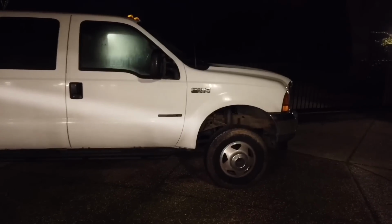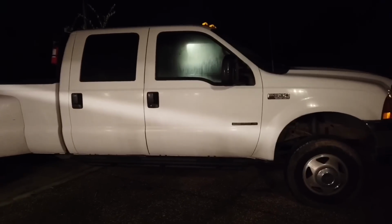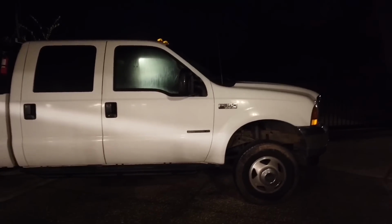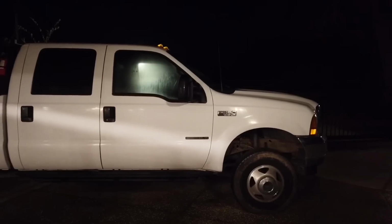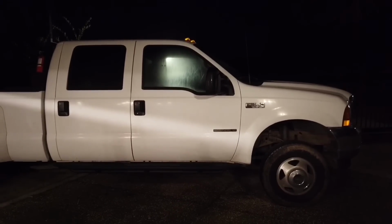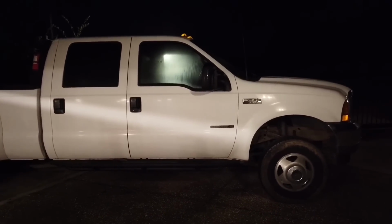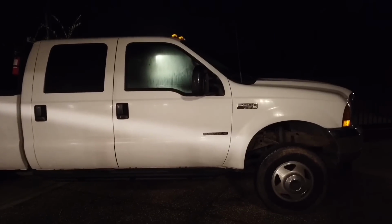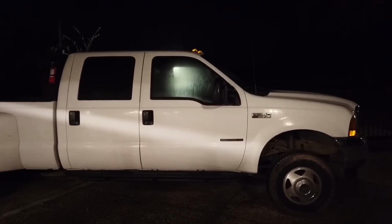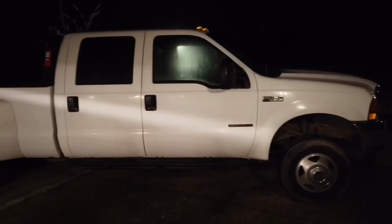All right, as you guys heard, she starts really easily, no problems at all, no hesitation. Idle's fine, no issues whatsoever. So I'm gonna let her run for, I don't know, maybe 20 minutes, 30 minutes, we'll see. And then I'm curious if she's gonna stall again. Hopefully in about 15-20 minutes she'll be up to normal operating temperatures, and we will swap the sensor and do the same thing. We're gonna actually start again and compare the difference, how she idles, and we'll go from there. All right, be right back.